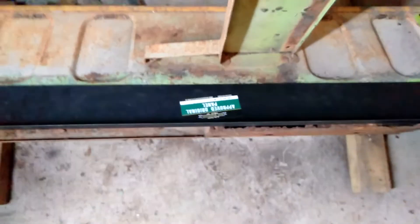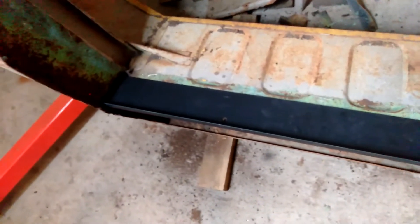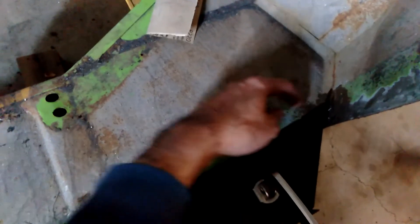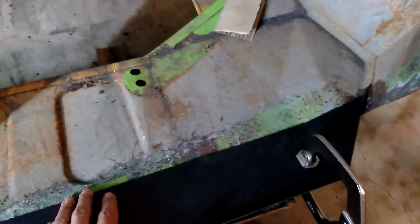That was a bit of a challenge to get this vertical panel for the seat cross member taken out, but I've managed to get that all out now - so that's ready. I'll do a test fit with the spare panel I've put down here - this is the upright section panel. I'm just test fitting to see how that fits in there. That actually fits nicely - the end of it, the creases in it, they all line up. The slit there, that crease, that bend across - I can see where things need to go now. That actually fits nice.